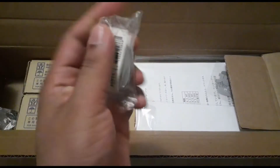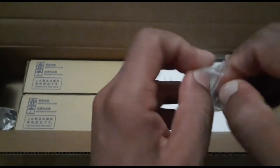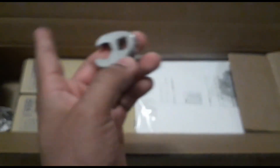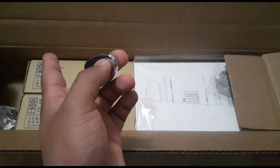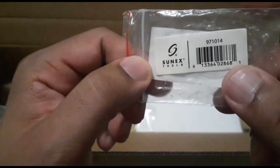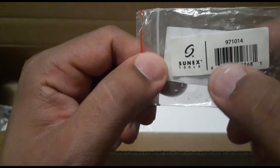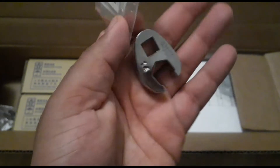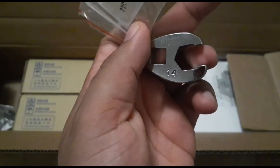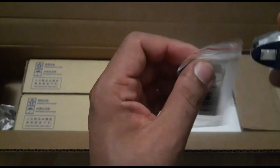There's a special little tool you need for the exhaust side — I don't recommend buying the Toyota version of this. This little tool is used to bolt the sprocket onto the exhaust camshaft. Toyota was asking $100 for it, but I got this off Amazon. The part number is 97101-4, and if not it will also be in the description below. It's only $6 on Amazon with free shipping — I ordered it on Saturday, today's Monday, and it came in the mail today.